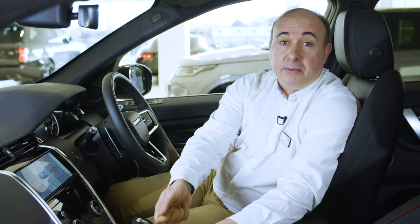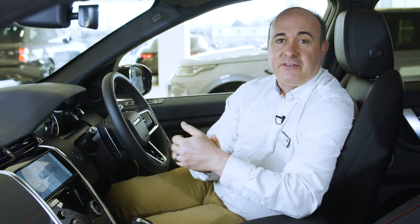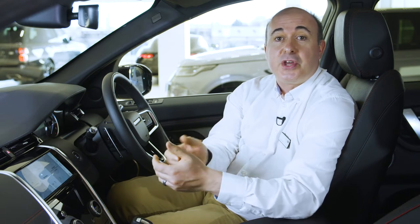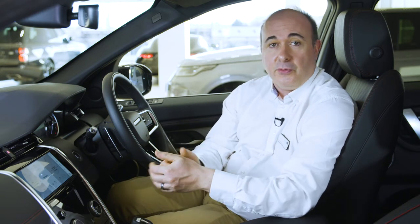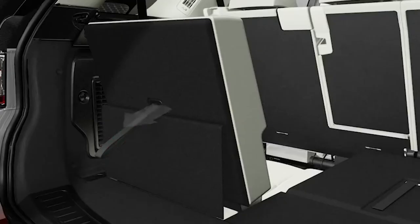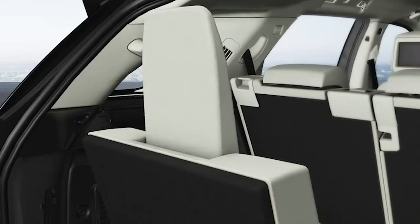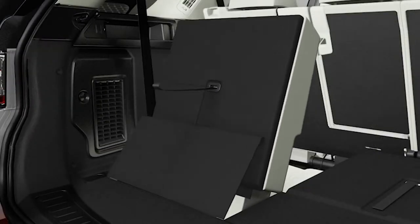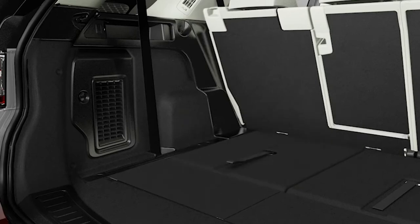To use the plus two seats in the boot, simply pull them out of the floor and then click the headrest into place. Access is via the rear doors. The release on the top of the second row seats will fold the seat and then roll it forward; once you've clicked it back in place, a bar under the seat will roll the second row forwards or backwards to share legroom between the passengers. When you're not using the plus two seats, they can be folded down by pulling the cord once — drop the headrest — and then once more to release the back of the seat to fold down into the floor of the boot.